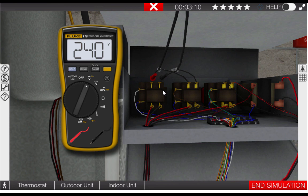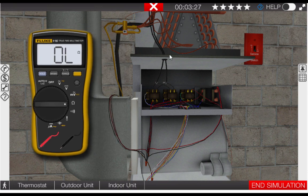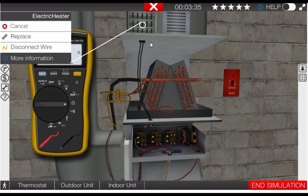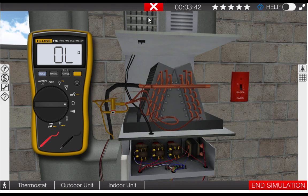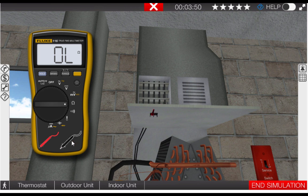At this point, we want to check the wiring connections and then do a resistance check of the electric heater. I'm going to turn the power off and turn the selector dial to resistance or ohms on the meter. Going back up to the heater, we need to disconnect the heater or isolate it in order to check resistance — click disconnect wire. Take the leads of your ohm meter and place them at the glowing hot spots on the electric heater. We should obtain a measurable resistance under normal conditions, but we have a reading of infinite ohms, which verifies that the electric heater is in fact open and needs to be replaced.